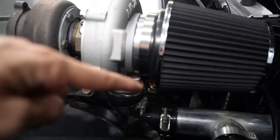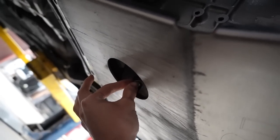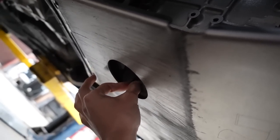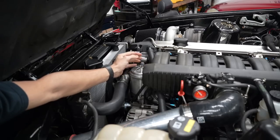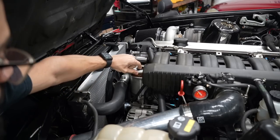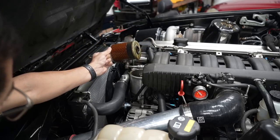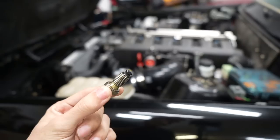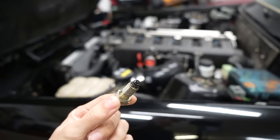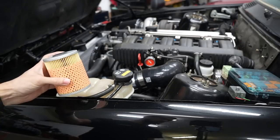I've got one bolt on that turbo tight. Now I'm going to lift the car and get the drain made from there to the oil pan. I'm going to drain the oil now since the oil level is sitting above this oil drain — I've driven about 475 miles, so it's about time for the first oil change. Look at all that oil. After the 470 miles, that's what my magnetic drain plug looks like — pretty sure that's normal sludge. Brand new filter going on.